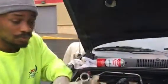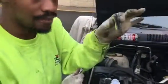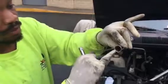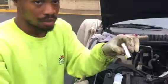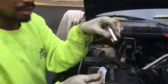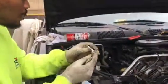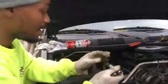Second thing you want to do is have the right tool. Please have the right tool for the job. This is a spark plug socket. Most vehicles will use a standard 5/8 socket. You'll notice when you look in this socket there's a boot — what this does is it grabs the actual spark plug so that when you take it out it won't drop down in. When you go to put it back in, it'll keep it steady so you don't cross the threads, which is easily done with spark plugs. If you don't have one of these tools specifically designed for changing spark plugs, get a piece of rubber garden hose and stick it on the end.